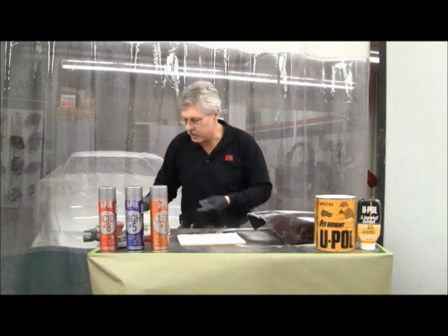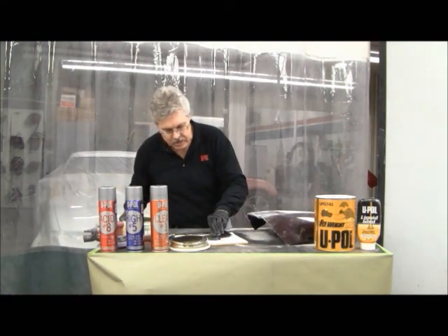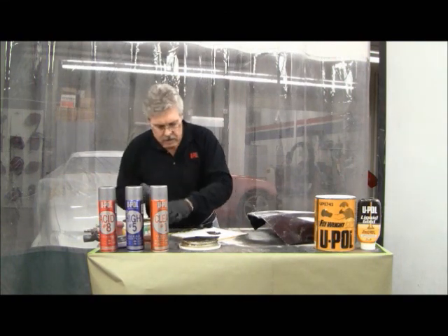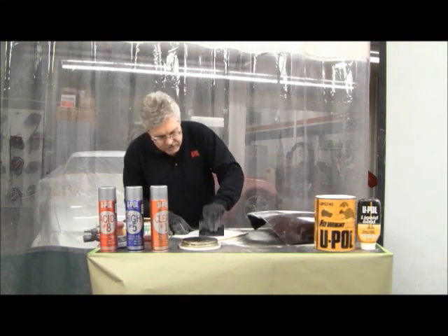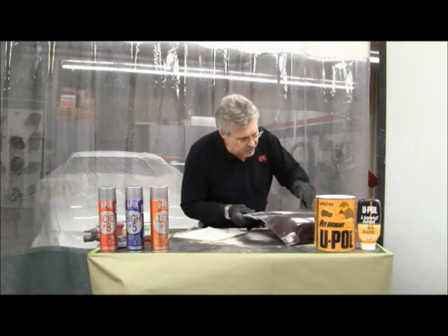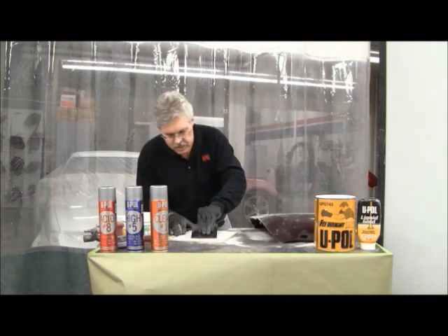Consequently, what we would want to do at this juncture is mix up a little bit more material and skim coat it right back over the top — mix up a smaller quantity of product. That's the nice thing with this material: if I do have a low spot, if I've got any pinholes or air bubbles, I don't need to use another glazing putty over the top of it — I can use the 706-1 directly back over the top of itself. I would come back in on this and spread that material right back over the top, just to fill that in, and literally just skim that material back over the top.